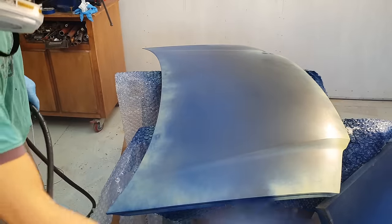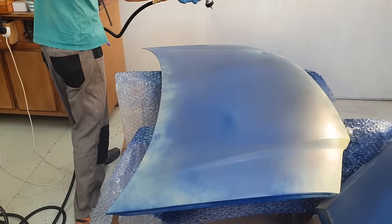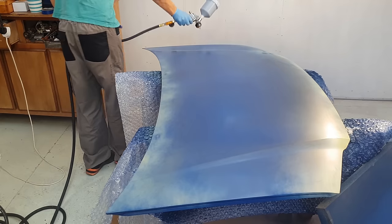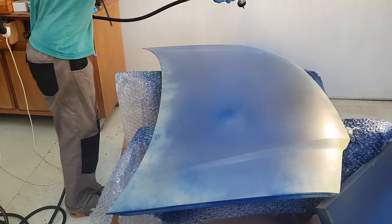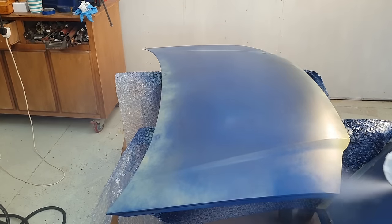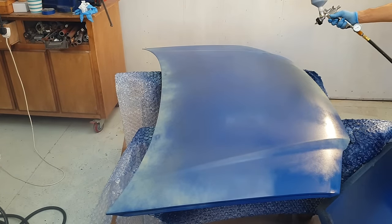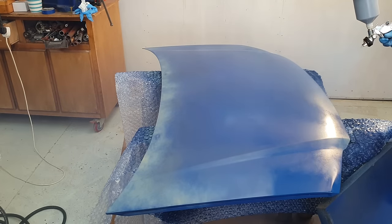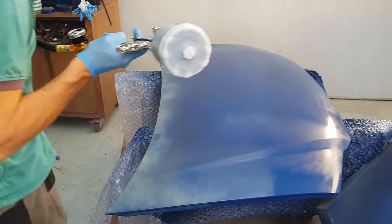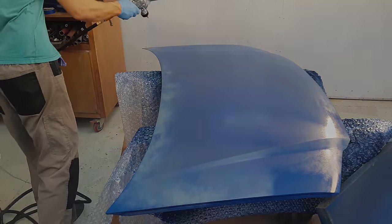As you saw before doing that, I had to put on some more primer paint because in some places when I was sanding I went down to bare metal. I know, I can basically hear lots of you slapping your own foreheads here and rolling your eyes. It's quite time consuming because each time you do that you have to wait for that to dry. Looking at the video, I think I probably overdid it slightly on the bottom right corner of that bonnet for the 0.5 coat, but apart from that I'd call that first half coat done.